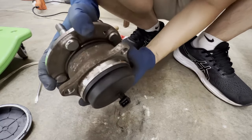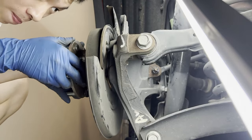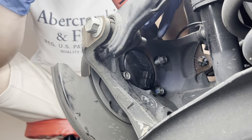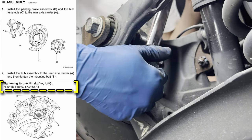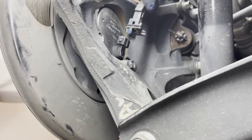Make sure there are no gaps between the hub and sensor. Put back the sensor connector. Now we are ready to put everything back together. Mounting bolts have to be torqued down to 60 foot-pounds in this case. Put back the sensor connector.